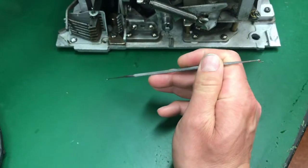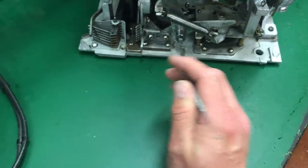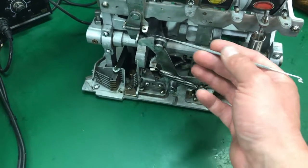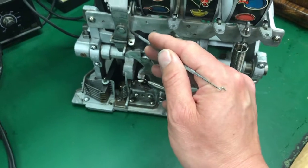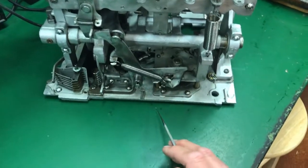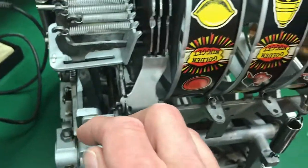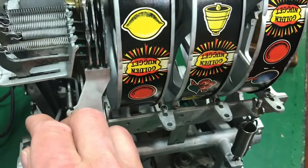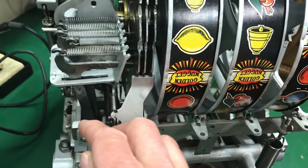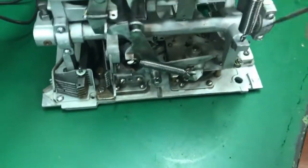These are the springs for those slides. I had to take them off and stretch them. Here's a spring tool I use — it's a copier tool, doesn't work for heavy-duty ones, but for small springs it's really nice. This piece here — I thought maybe the plate was bent because it wasn't coming up. After regreasing everything it's moving really good. These little parts that are supposed to spin — I got that spinning. There's a little stop up here that contacts this, and it was completely seized, wearing unevenly. Now I got the brass shaft spinning on the inner shaft and the inner shaft also spins.